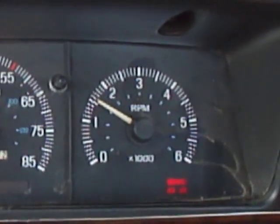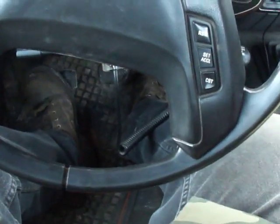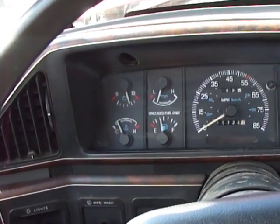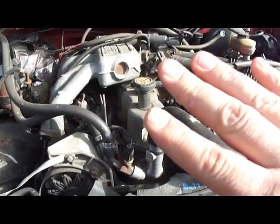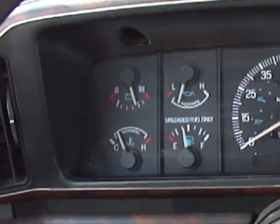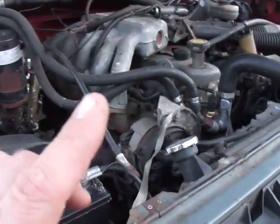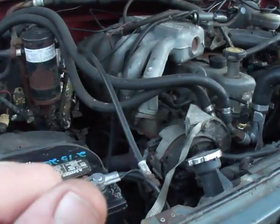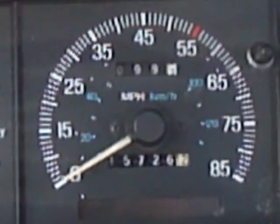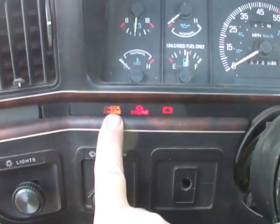The purpose for turning the steering wheel is to check the power steering pressure sensor if equipped. Pressing the brake checks the brake light switch, and the full throttle sweep checks the throttle position sensor through its full range of motion. The computer is gathering data from all systems: the oxygen sensor, exhaust gas recirculation sensor, manifold absolute pressure sensor, throttle position sensor, coolant temperature sensors, air intake temperature sensors, timing curve, idle air control valve, vacuum solenoids, and the secondary air or smog system.